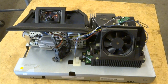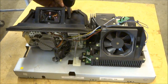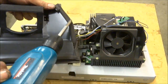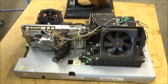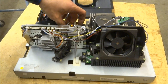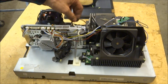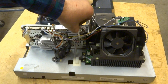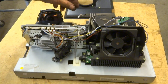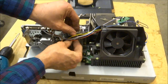Start by taking out the two screws that cover the lens. This is the gasket assembly — it has some foam rubber around it to keep the lens clear. Next, there's a piece of conductive tape back here — carefully remove that. Unplug the one ribbon cable for the color wheel motor. The second ribbon cable is a little three-pin cable that's the optical sensor detecting the phase of the color wheel. Get these wires out of the little tie.